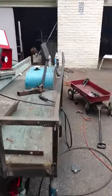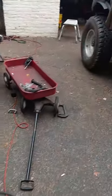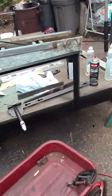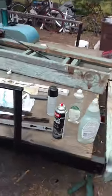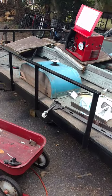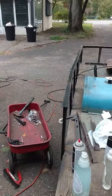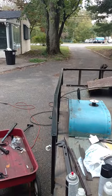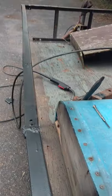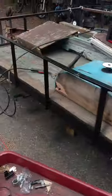We're doing it with bed frame, and yes, I know she's real crooked right there, but there's a reason for that. The frame itself is bent right there, and I welded that at the bottom along the frame, and just kept going with what I had and didn't notice. We have a seam right there. Had that seam been welded before that happened, we might have been able to straighten it out, but I just assumed and messed it up.